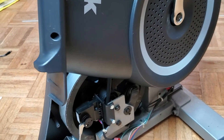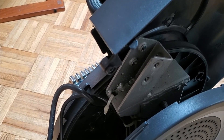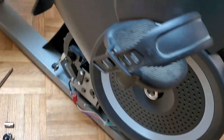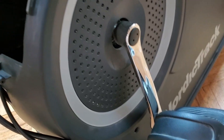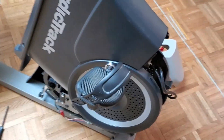To make this easier, I've removed the console as you can see. That part takes the allen wrench, but you can actually leave the console on — it just requires a bit more bending of the plastic. You take all the screws out, and from this position it's really easy to see where the screws are — about five screws total. The surprising one is there's one on this side down here which you wouldn't necessarily guess.